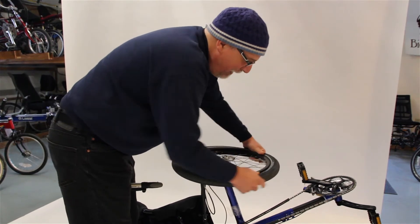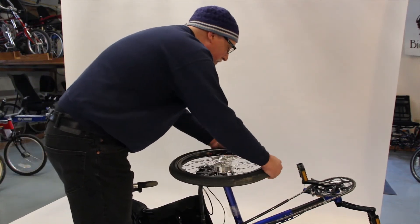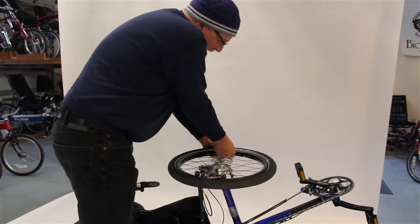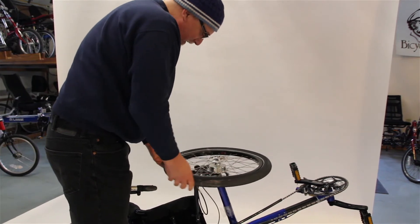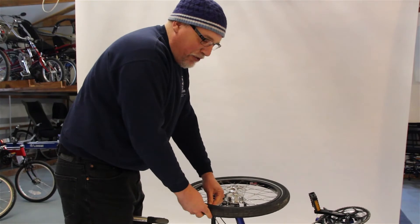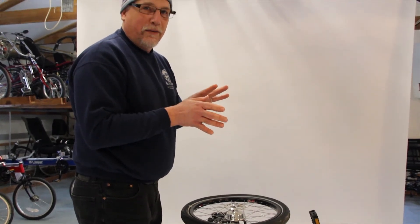Then I'm going to go around and tuck the tube inside of the tire. Since it's got a little bit of shape, it's not going to fold over on itself or be all wrinkled up or twisted. This should be something you can do with your fingers instead of using tire irons — on a trike they're pretty loose. Once I've got that in there, I'm going to push the stem this way a little bit so I can get the bead started right here, then work my way around and tuck it in. I pull the stem back out and down — by pushing it out of the way first, it lets the bead tuck in cleanly, and then when I pull it down it traps the bead and the tube sits in there perfectly.